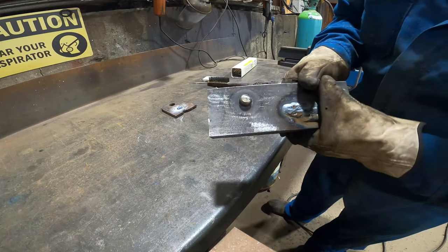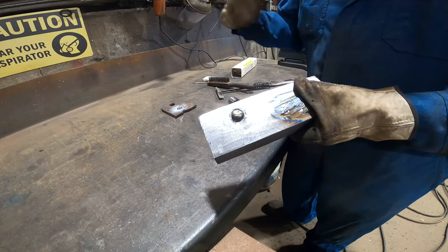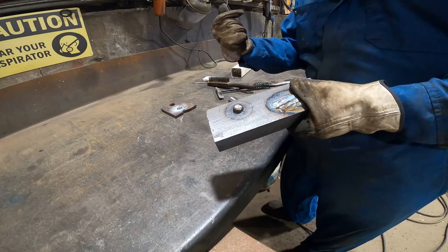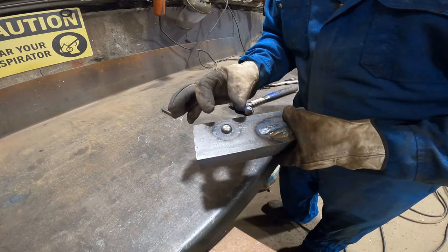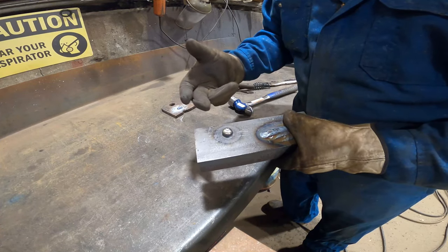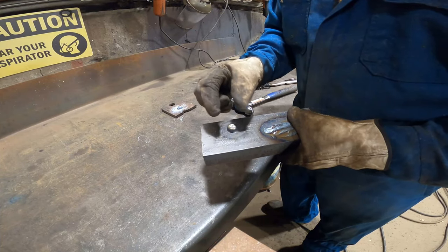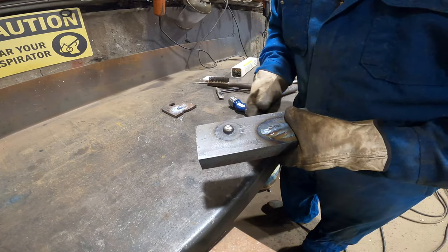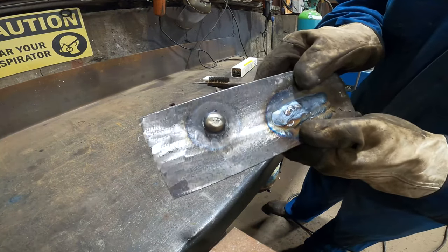This pin would probably be the right size for like an International Hendrickson — Freightliner also has about that size. The Peterbilt Low Air Leaf actually has a narrower one, so all you have to do is take a little die grinder, shave the sides down, and it will make it oval, because the actual plug in there is actually oval. But yeah, that's how you do it — nice little pin.